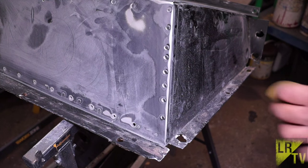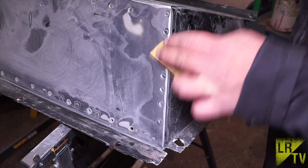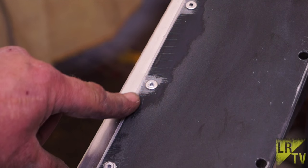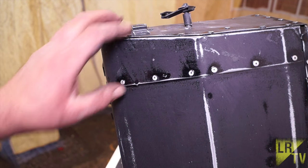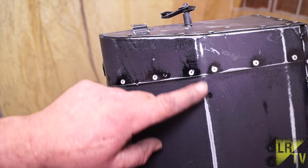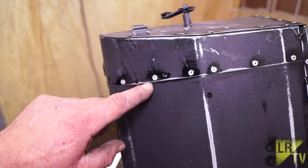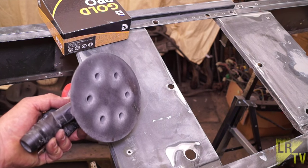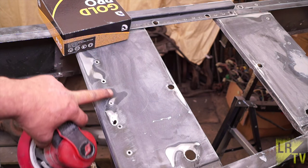As I stated earlier, if you're going to be painting this — which I would imagine you will be — key down the box around the area underneath the rivets. Using a wire brush is a bit aggressive and this can be filled with spray putty. The reason is, if you rivet and then key it down, you'll find that you can't get all the paint underneath or around the rivet, which means the paint won't stick properly. You can see on this heater box that we flattened earlier — it's going to need a lot more work to be able to paint it. Using an orbital sander is the best way to key off or sand down a flat surface or a panel.